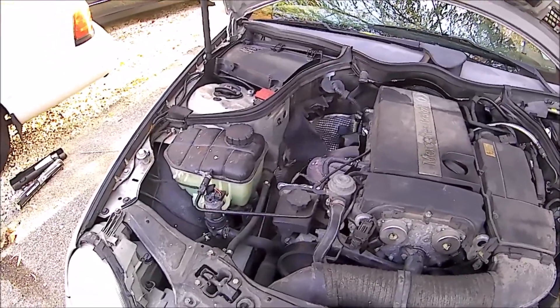Before we head to the passenger side, we're at like 13 psi on the pressure test. As you can see, we have a leak — so she wasn't wrong, she is smelling coolant. I'd wager it only leaks under pressure, so when it gets warmed up it's leaking. We can see it's running down the side of the bell housing and dripping off. Since the car is jacked up on the driver's side, it could be coming from there and running over to the passenger side.